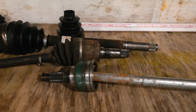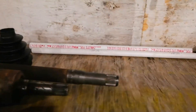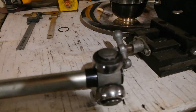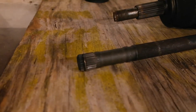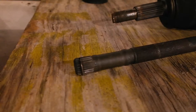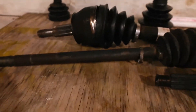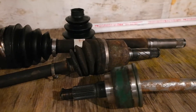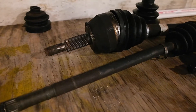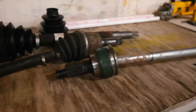I am having custom shafts made that are going to adapt the Ford 8.8 inner tripod bearing to the Miata outer CV. I have a rough idea of the length that I need, but since I pretty much made my own custom subframe from the stock Miata subframe with the Ford Explorer 8.8 — which a whole lot of people haven't been using — they've been using the T-Bird. So I'm not 100% sure exactly how long the axle shafts are going to need to be, and I can't really base judgment off of what other people have used, like the swap kits and stuff like that.